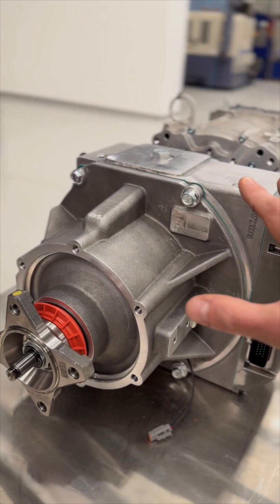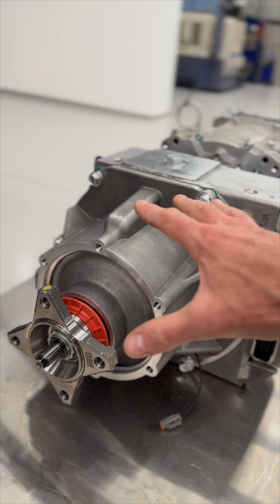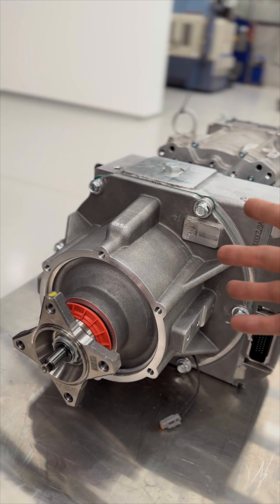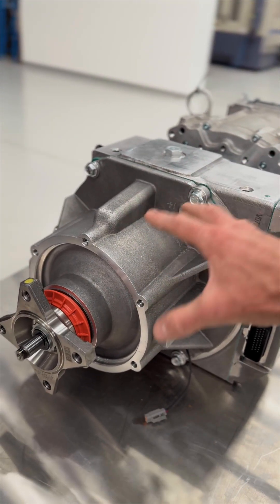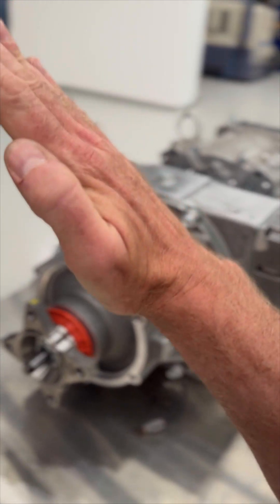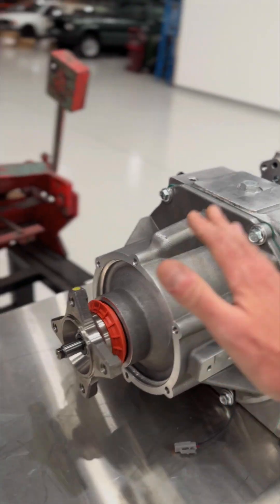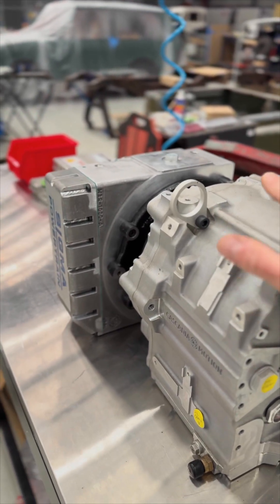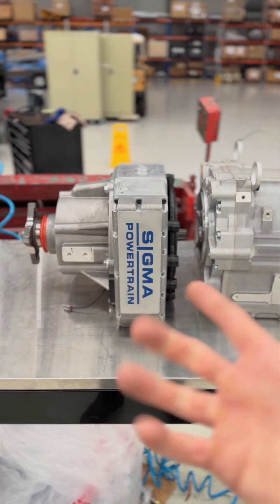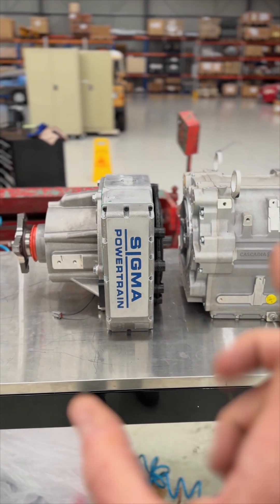And this is explicitly for doing things that electric motors have not traditionally been able to do, particularly in a conversion application. This will be going into a vehicle that is about six tonne, fully loaded. The reason you want this is there's plenty of motor and power, but you need reduction — torque multiplication essentially — for doing things like taking off on a very steep grade and efficiency at high speed, at high weight and speeds. It does an amazing job of taking a very powerful electric motor and making it even more powerful and efficient in a very small package, with a 3-to-1 reduction, a 2-to-1 reduction, and a straight-through 1-to-1 reduction, with very good smarts in software to make it shift perfectly.